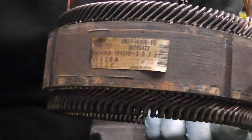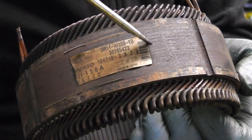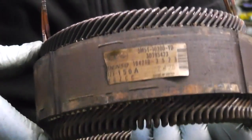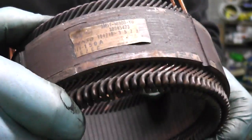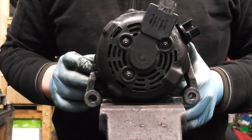This stator is burnt out — very easy to tell because the sticker is browned and has shriveled from the heat. You can see the glue line on the side where the sticker was bigger and shriveled from the temperature. If you look at the outside of your alternator and see the sticker in that state, it means you need a stator as well as a rectifier. But if your sticker is nice and silvery, it's more than likely only a rectifier problem.